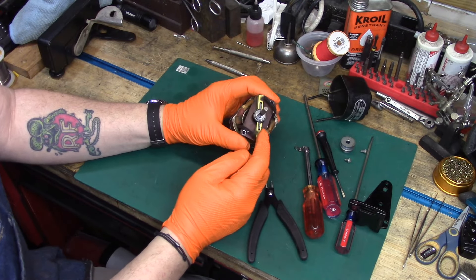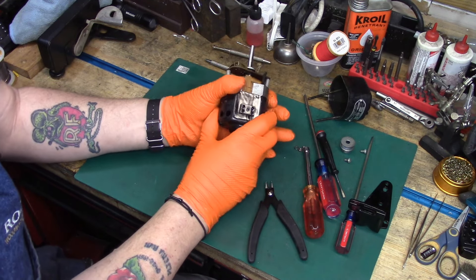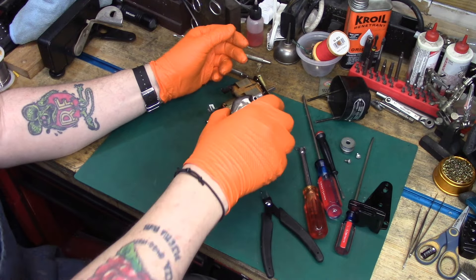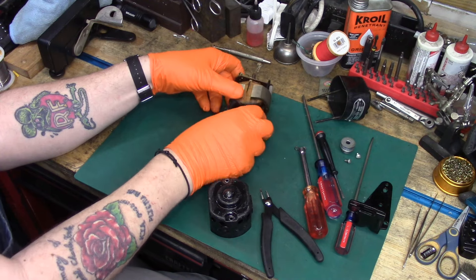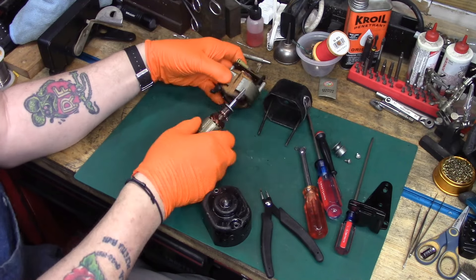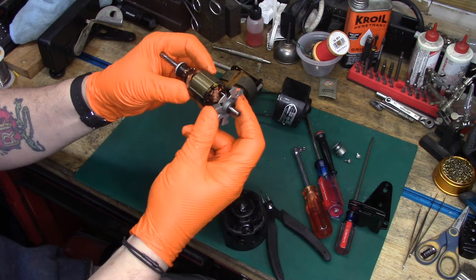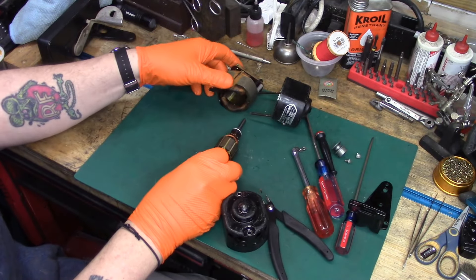All this wire in here is in really bad shape. We're going to cut that a little more flush with the housing, just to facilitate getting this out. The front end is going to want to come off first. There we go - you can see those big long screws going through the brush holders and the plates for the brush holders. Now there's a washer that belongs on this end of the shaft. No washers on the front. And we have the armature assembly - the fan blade's in good condition.